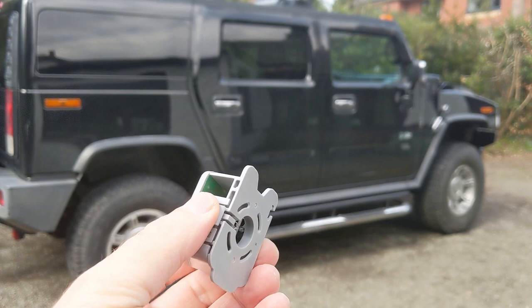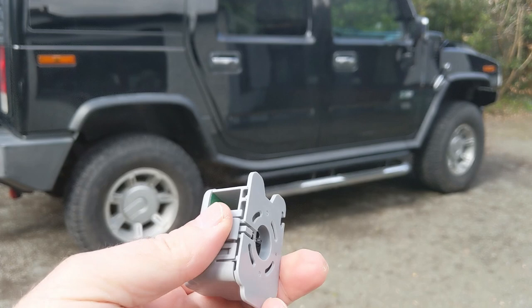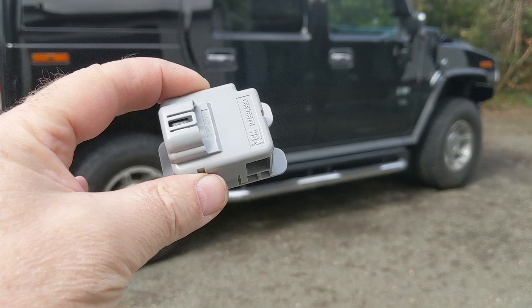On this new one you can see that the thermistor is in the centre of the port on the bottom. They've also improved the fan system inside so that it actually sucks air in and circulates it through, which I think is probably an improvement in performance. Given that, I'm going to swap out the one that I've got in there at the moment.